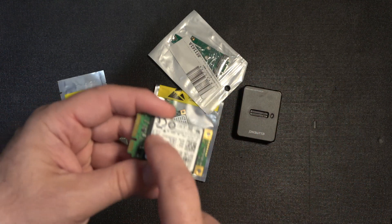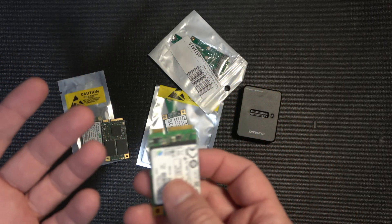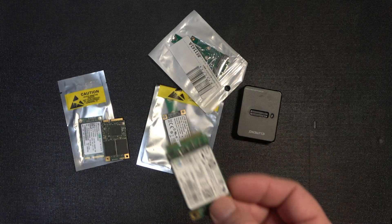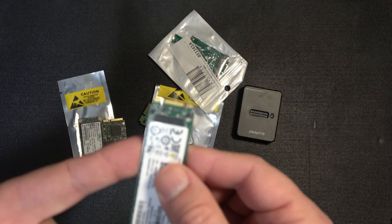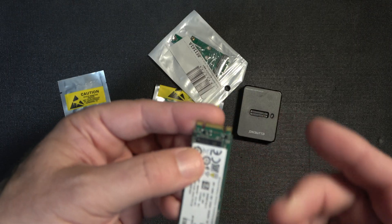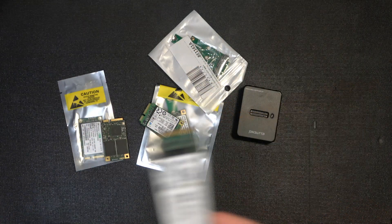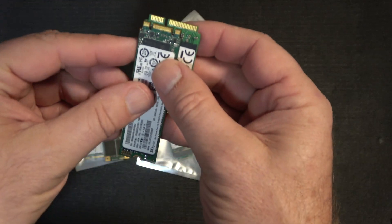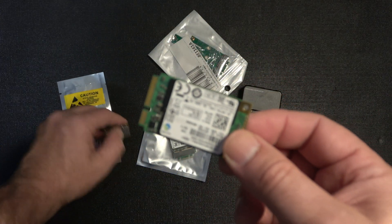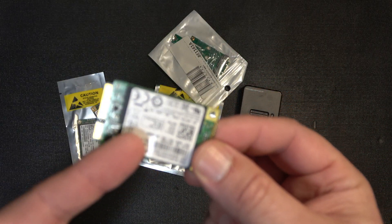In this episode we're going to talk about these old mSATA drives and what we can do with them today. They're almost useless unless you have appropriate era hardware for them to fit into. This is what we call an M.2 SATA because of the two slots, and then we have the NVMe variant which is a one slot and full bar — those we can always use because they fit in the other socket. But if you're like me and have a bunch of these lying around — even one terabyte, 512s, and 256s — you want to use them.